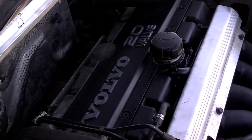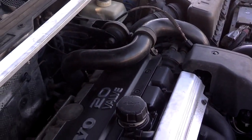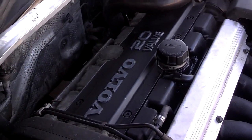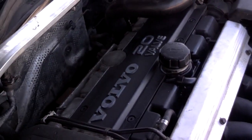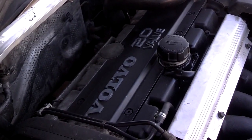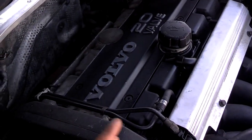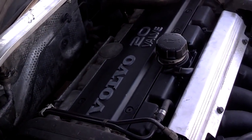Now, I would disconnect my ignition system so that my spark plugs are not trying to spark, but I would have my fuel pump, my fuel injectors working, and as your pistons go down and up, they will be ejecting that moisture out of your cylinders. And I would do that for probably a minute or two to hopefully get to the situation where there's no moisture or water in your fuel injectors. All of that has been pumped into your cylinders and hopefully ejected out of your cylinder.